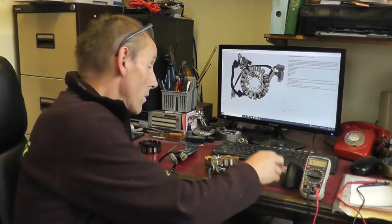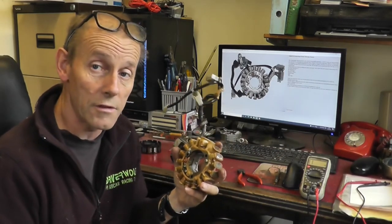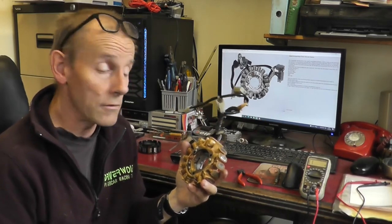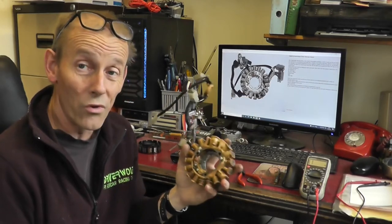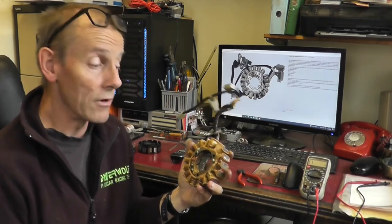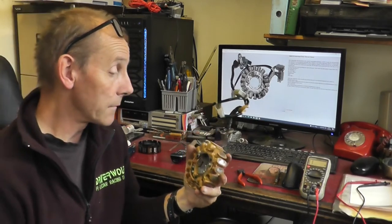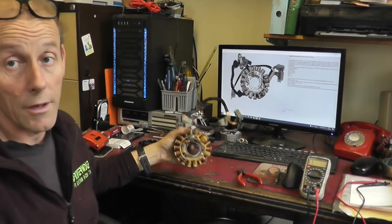Here's the other one — you might see better that coil there. Rust has got into it and critted it all up, even though the readings are okay on that one. That one won't be working properly to advance the ignition. I'm guessing that's what it is — that's another one I got to do that came in yesterday. So yeah, get down in the workshop and start stripping it down. You've got to be brutal with these things to get them apart — they've got resin inside, set for 40 years, tough as old boots. Most of the work is stripping them down, and the actual rewinding doesn't take so long. It's the stripping down and preparing them that takes the time.